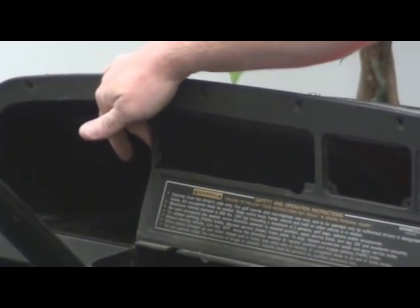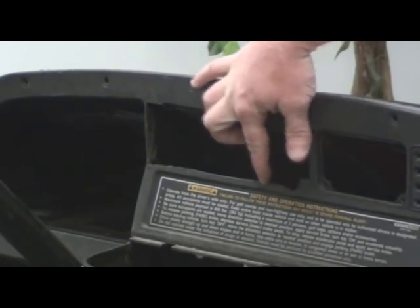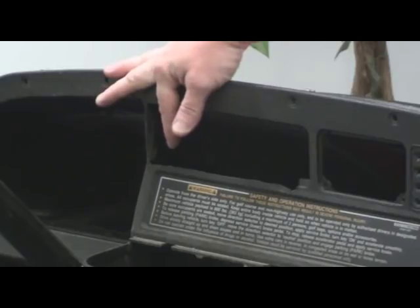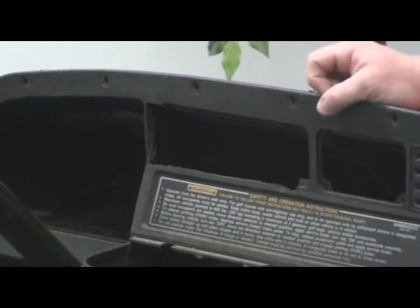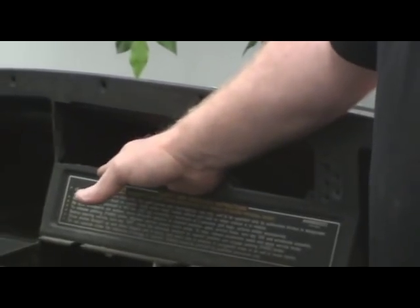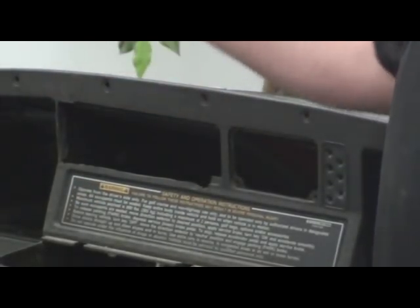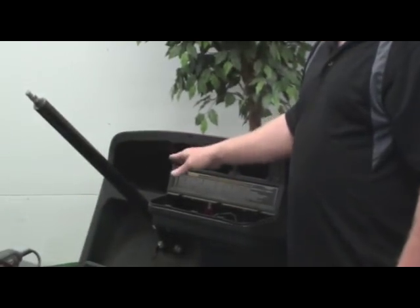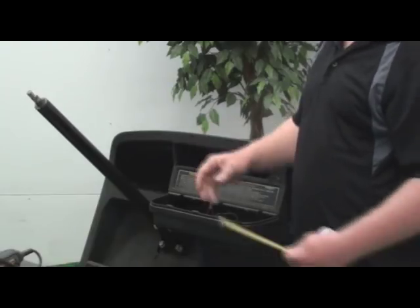You can cut through the wall of the ball holder and go all the way to the wall of the glove box — one half inch down, all the way through the wall of the ball holder and all the way up to the wall of the glove box. What this does is it adds a shelf and extra stability for the radio. Our dash actually protrudes a little bit to make things easier for you to reach, and when the radio goes through, this adds an extra shelf and creates all the strength you need for your radio.